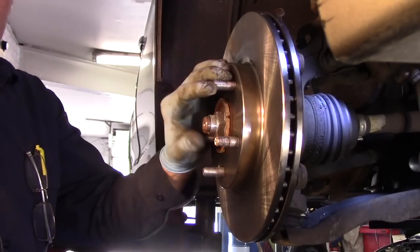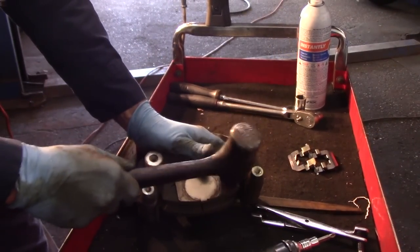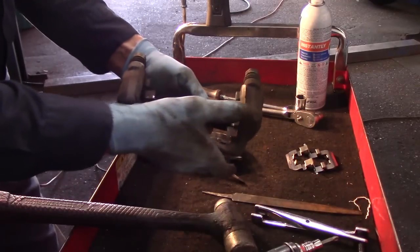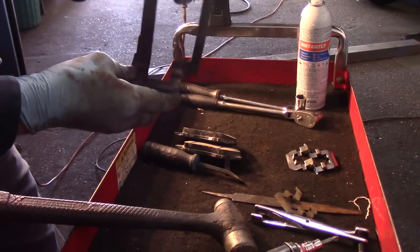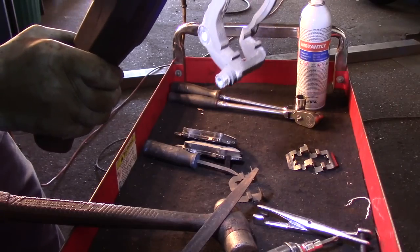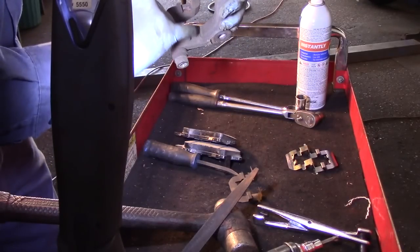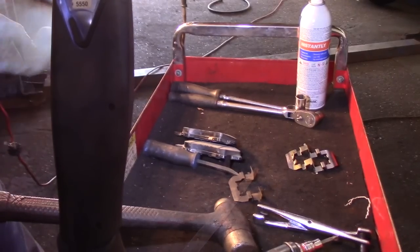Okay, so now our rotor is nice and tight. Let's go to the bench — I'm going to show you how to do the hardware kit. These are the brake pads; we're going to just tap them like this to knock them out. That's the indicator I was telling you about — you can see where it's touching right into it, and that's what was giving the squealing noise. Take this out and then we're going to take out these clips. If it was rusty inside here, we would clean this up with a file or emery cloth, but as you can see it's fairly clean.